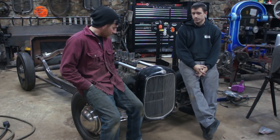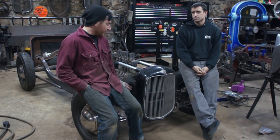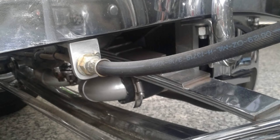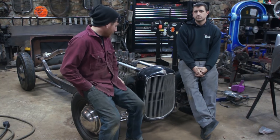I'm pretty happy with how everything looks — even in the back, with how the hose follows the crossmember really nicely. It all flows well. It looks kind of like it's supposed to be like that — it doesn't look too forced. The big problem with this whole radiator setup, dropping it in front of and below the crossmember, was the hoses. All the old cars I've seen done this way back in the day — they shoved hoses between the spring and the axle, or did some weird snaked point lines, or used bendy hose. Like the Casa Coupe — a pretty famous '32 that has a similar setup — the hoses go under the spring, around, and loop back up. It's kind of weird. But I think this is probably the cleanest way I could think of to do it, and it worked out pretty good.